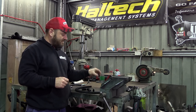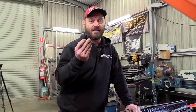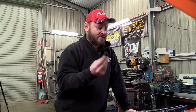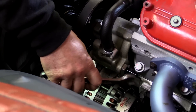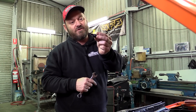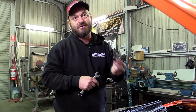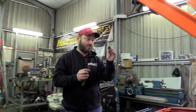Once you've got these, screw them in - you convert it over to dash 6 AN and then we can start on our hose manufacture. Once you've got your adapters sorted, go and screw them into the appropriate spots on the vehicle. The LS1 Australian version uses a metric fitting - it's 16 by 1.5 with a bump tube, so that just screws into the outlet. It doesn't need to be rattle-gunned up, just needs to be tight like most o-ring fittings. This one for the steering box is imperial - it's an old GM car, so it uses imperial, I think it's 11/16-18 with a tapered seat. It was originally a flared pipe with a tube nut and now we're changing it over to just an adapter.